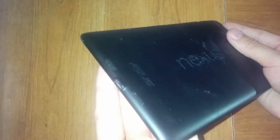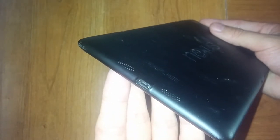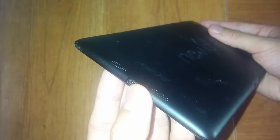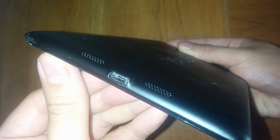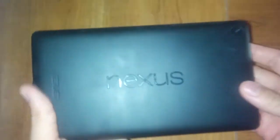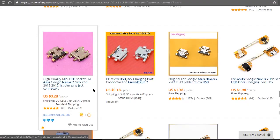One way to solve this problem is by using something to tighten up that USB port, squeezing it together so that the port would be nice and tight so that your micro USB cable can get up in there, or you push that cable up or down or wiggle it a little bit and see if it charges. All that actually failed on me. The other way to fix the problem is by desoldering the actual USB female port found on the board, then finding a replacement online for like a dollar.